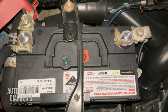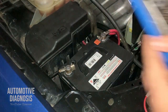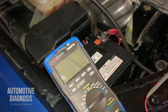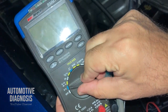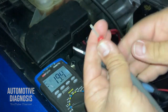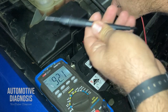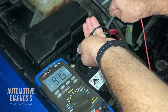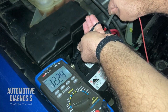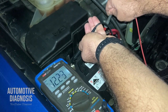Here is my battery — I'll grab the multimeter. Select the voltage function on your multimeter, place the red lead on battery positive and the black lead on battery negative. As you can see, I'm getting 12.2 volts. You want to make sure that the battery is not flat and that it can crank your engine.